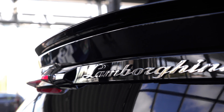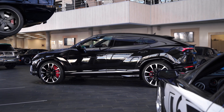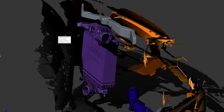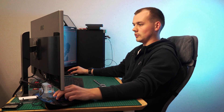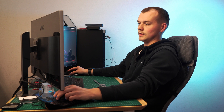Cars of this caliber are often modified, receive a tune, and so on, which is obviously going to increase the power. That in turn will involve increased airflow, higher pressure, and higher temperatures as a consequence. That means we have to make this intercooler more efficient and increase its volume for it to absorb heat more effectively — by increasing the volume, or by increasing the density of the core or matrix.